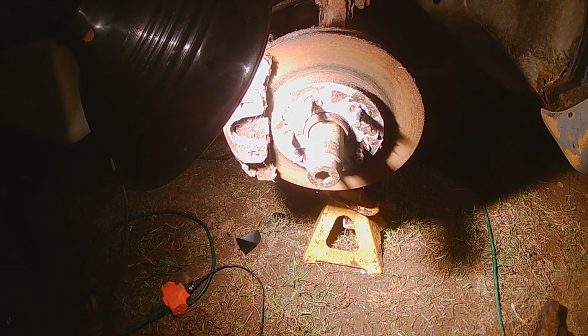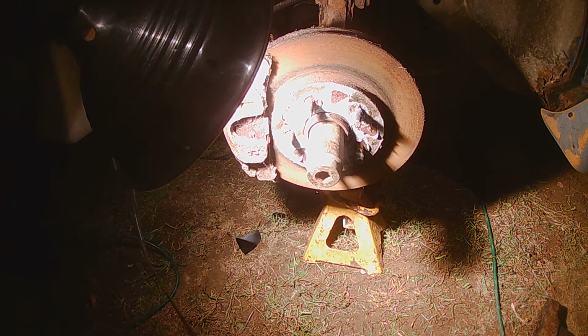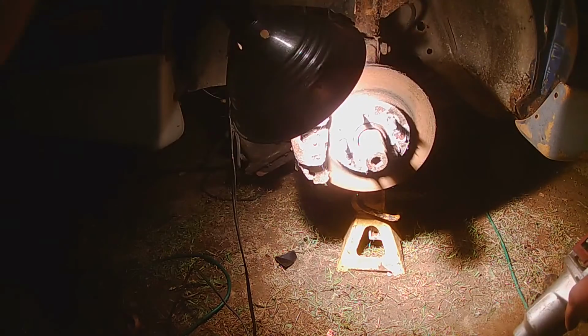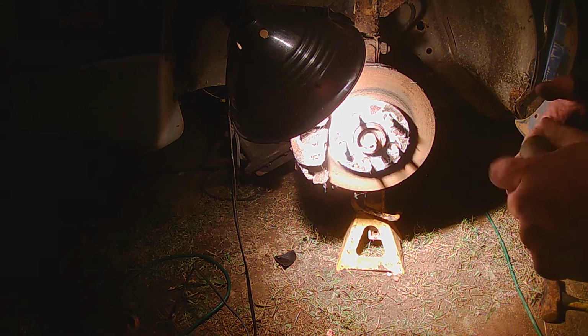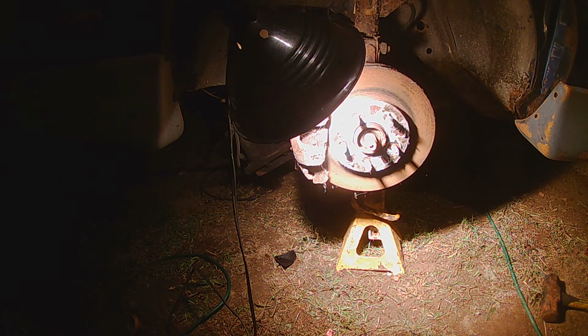So I found out after I took the steering tie rod ends loose. Oh, here I am trying to find what I did with my 1.25" socket, because that's what fits those. By the way, if you're taking those big old nuts off of these things, it's a 1.25" socket. And the tie rod ends are, I believe, 18 millimeter. I could be wrong on that. I know the one was. I think I broke my socket. I cracked it, or else probably the other one would be the same thing. If they're not 18, they're 17, or whatever the Freedom units are that correspond to that.